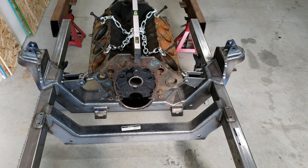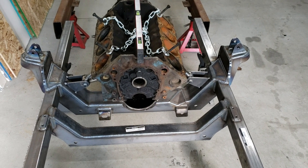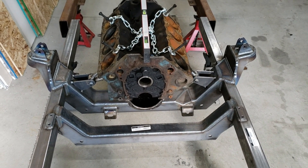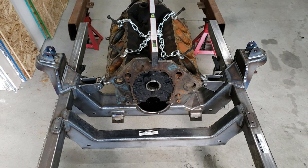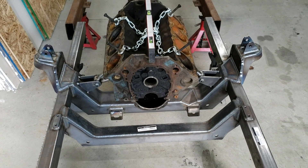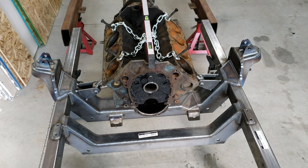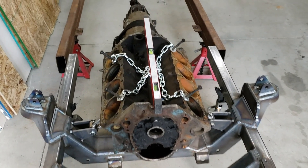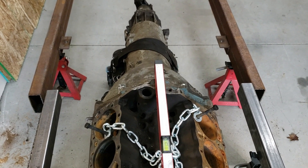This suspension came with a power steering rack and pinion, however it's for hydraulic power steering. I'm going to get a little tricky here and put electric power steering in this instead. So I actually had to order a Mustang 2 manual rack and pinion steering. When that comes in I can get that assembled and then move on to finishing the installation of the knuckles, spindles, and everything else for the front end.